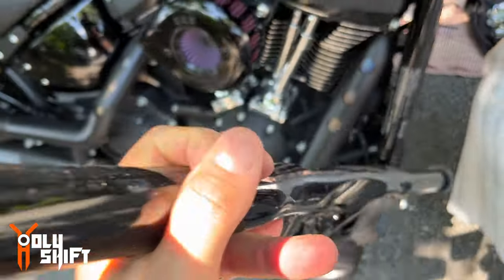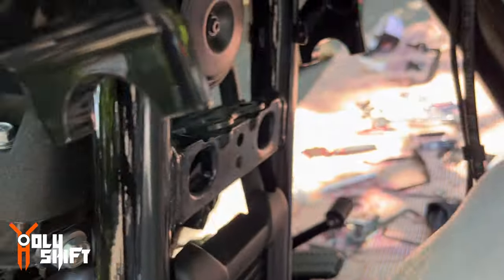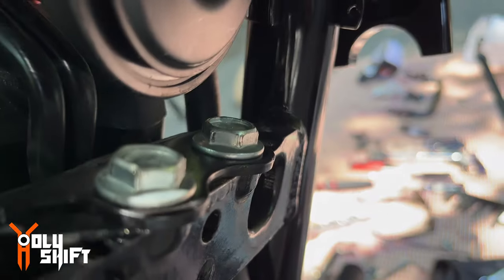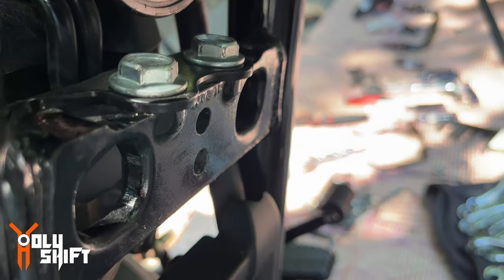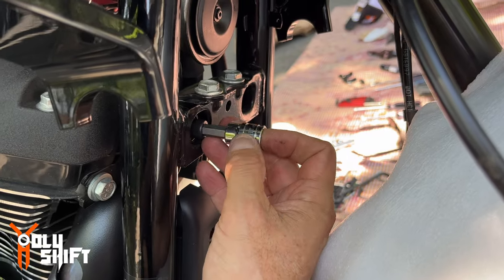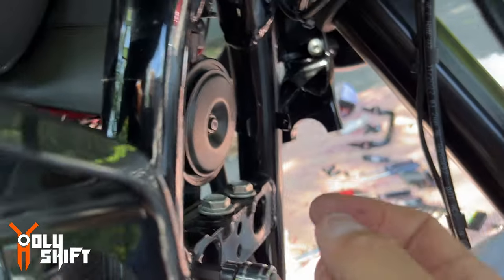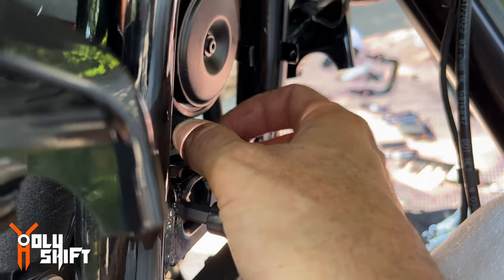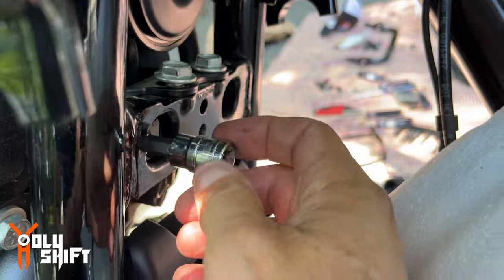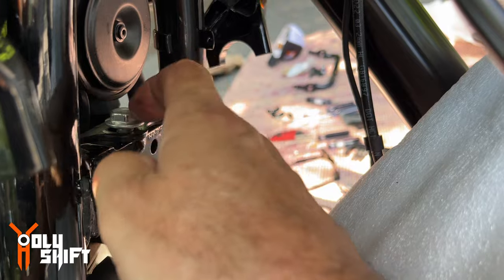The flat out bar. I can tell you something, it's pretty heavy. It's very heavy. These bolts go back in right there. Back on. And now we're gonna put the two bolts that go for the engine mount. I had to release to unscrew these so I get some wiggle with this plate. Loosen it up so it moves, and then it's easier to get the Allen bolts in. Tighten these two, and at the end, tighten the top.